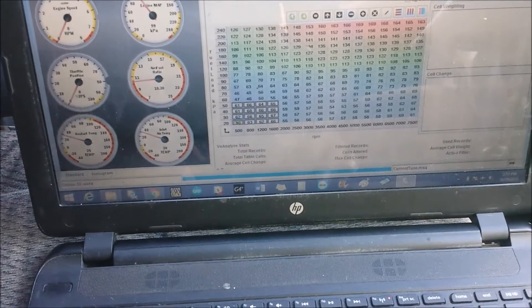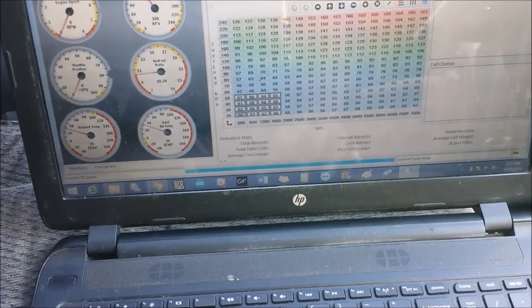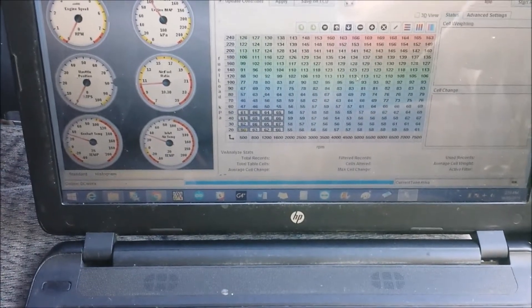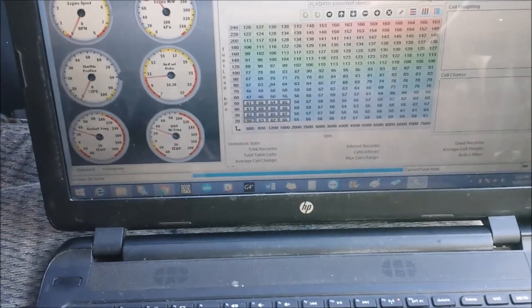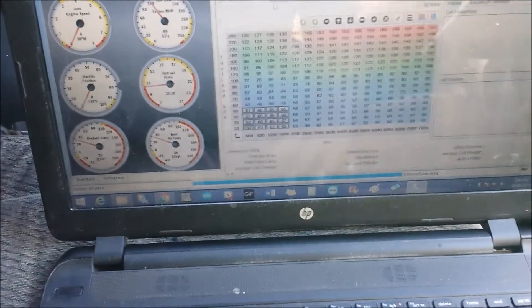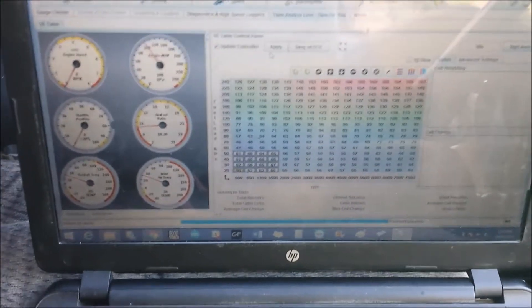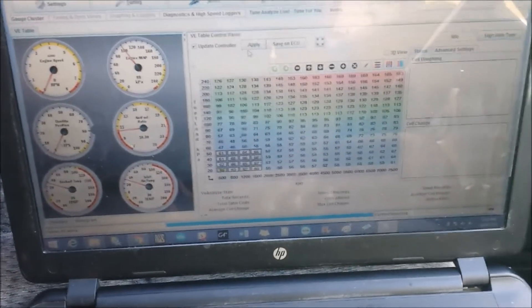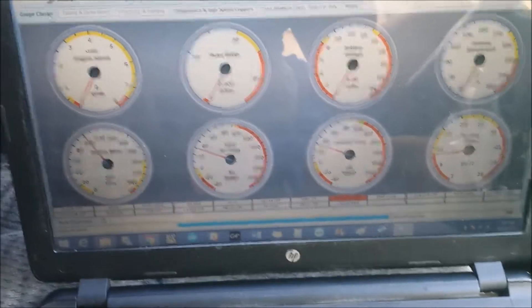Here's how this works: this is the current fuel table. While driving, the software will just be trimming it — adding or removing fuel based on the fuel ratios you're hitting. It does this in real time, and I also have it set so that it updates the ECU as we go. You'll be seeing my fuel ratios shuffle in the background. We'll just be driving along and hopefully clean up the map. The car is on eight pounds, so we're not expecting anything spectacular.